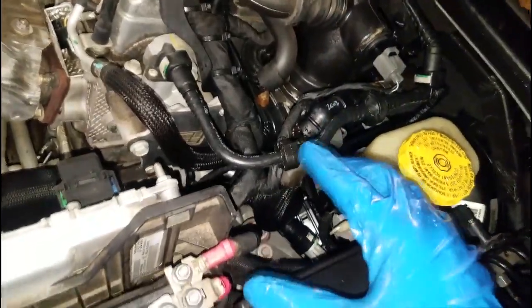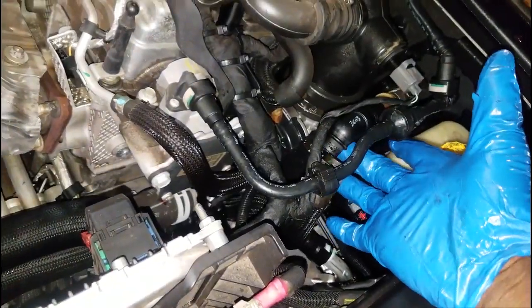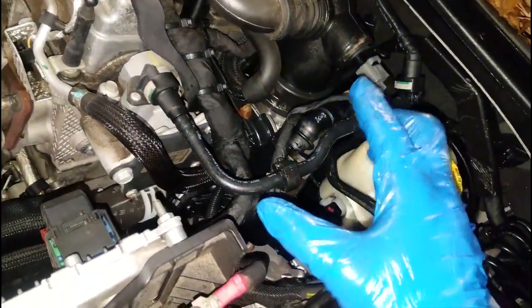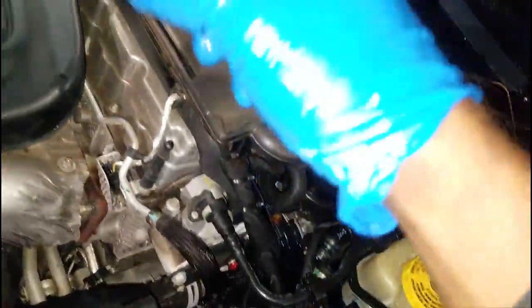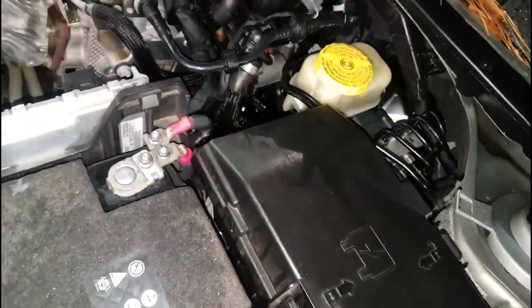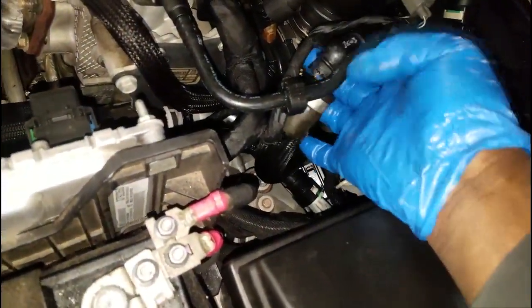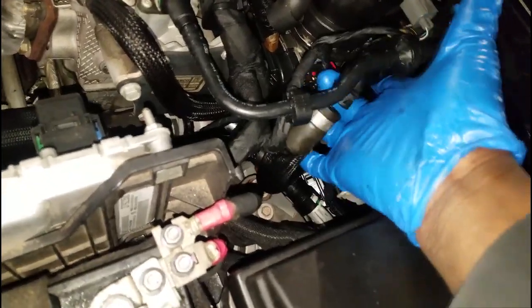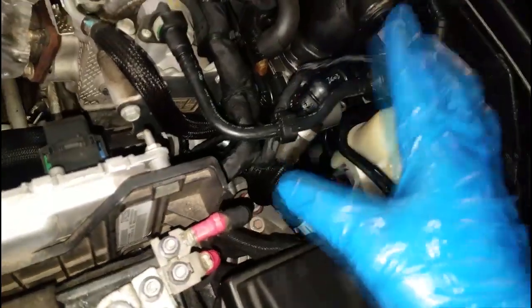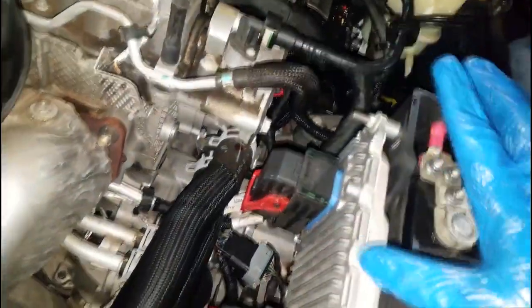Before I can do anything else I'm going to let the car up in the air and check further. But before you can really address the leaks, you've got to get this fixed, then refill the system, pressurize it if you have the adapter, and do your test all over again. This is the starting point — we call it 'start here' at the dealership. We need to get this hose replaced and refill the system.